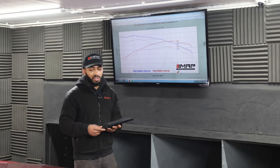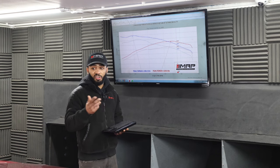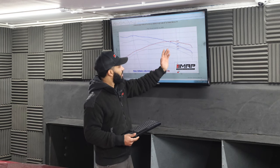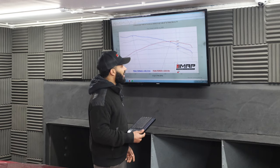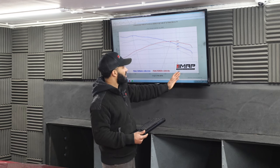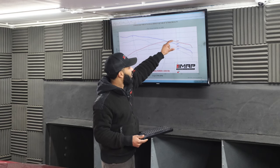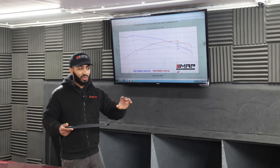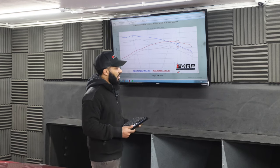With this being the 10R80 car, we've tuned the gearbox and optimized the shift points. Because we've been able to make more power at the top end, we can raise the rev limit slightly and shift the car later. The gains are massive between 4,000 and 6,000 RPM where the EcoBoost starts to struggle because of the turbo — we've gained quite a lot of power in that area. 320 wheel horsepower equates to somewhere around 385–390 brake horsepower, and this is tuned on 99 octane fuel.